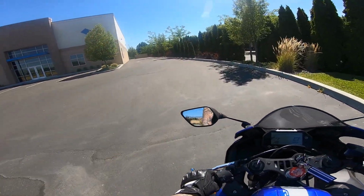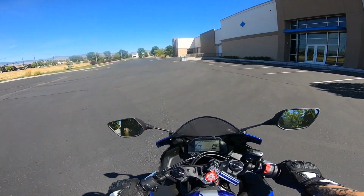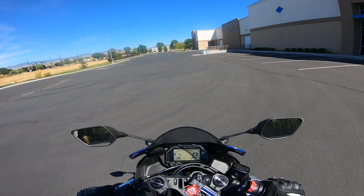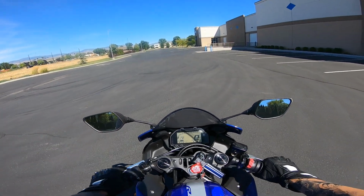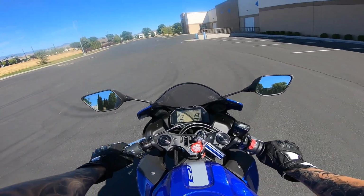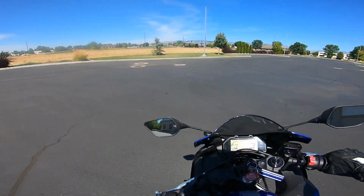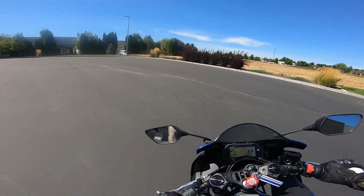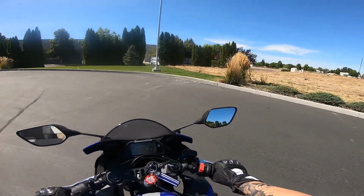Okay, so let's see, I'll do it one more time actually. So we're stopped. Okay, we want to go. Let's let off the clutch. We'll find the friction zone, give it a little bit of gas, let off the clutch slowly, and there we go. Just like that.